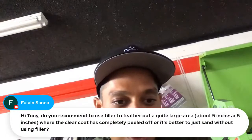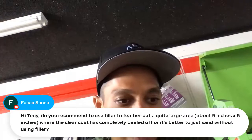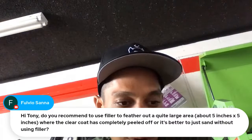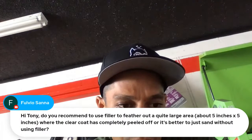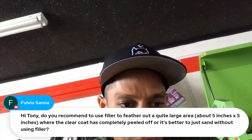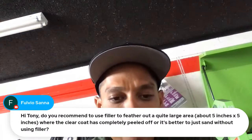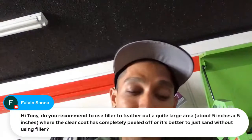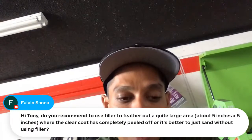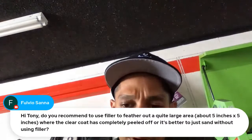Hi, Tony. Do you recommend using filler to feather out quite a large area, about 5 by 5 inches, where the clear coat has completely peeled off, or is it better to just sand without using filler? Well, it depends on what you're filling. If it could be sanded out without filler and feathered out, then do it without filler. Just use primer and block it out. But if you need to add a little bit of putty, then you're going to have to add some putty to that. Hopefully, maybe I didn't understand your question.